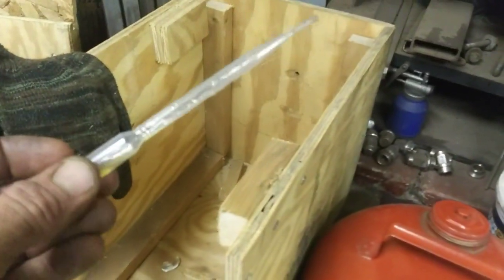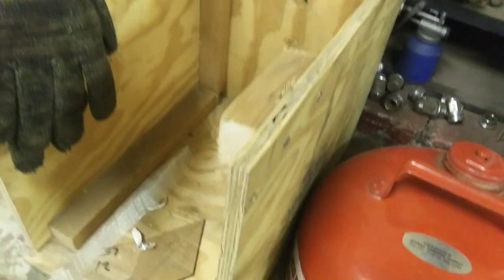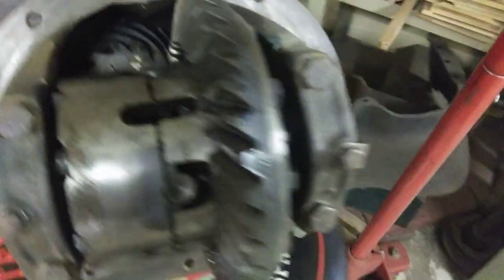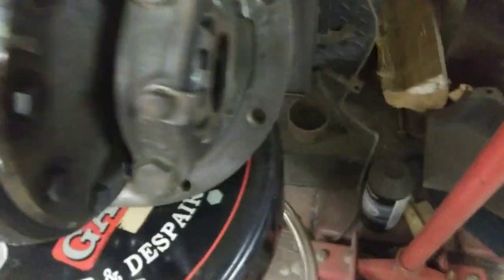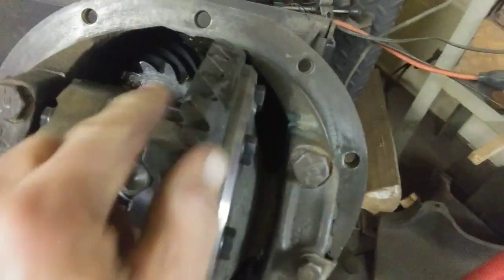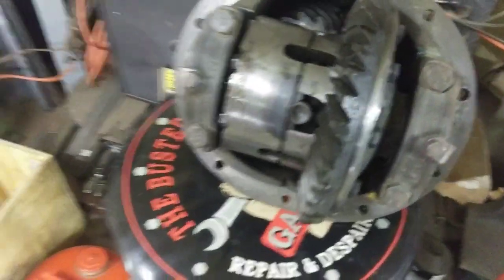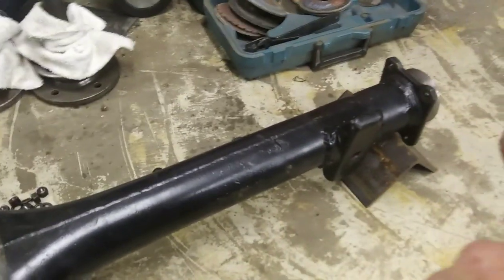I've got this little vial — a little squirter — and I've been putting a little bit of gear oil in there because I blew it all out and it was pretty dry. The bearings are all nice. I squirted a bunch in there, around the ring gear and the pinion gear, down in those clutches, and on this bearing. I sat here and spun it around for a while — it's nice and quiet. I wanted to get a little lube in there so it's not dry when I get the axles spinning.